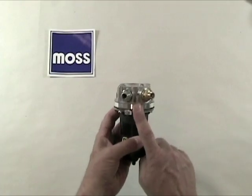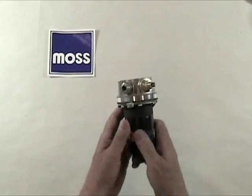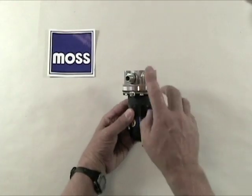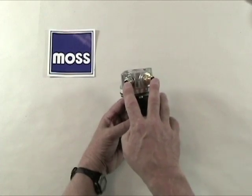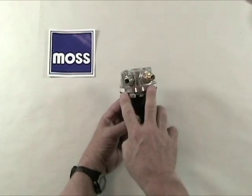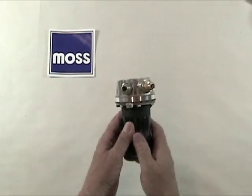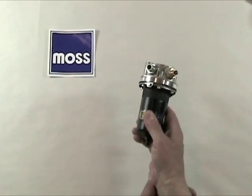If the original fuel pump in your car called for fittings like this 377-042, and those fittings were cut off, you could be in hot water. Those fittings are an odd size. Okay, you can't just call Moss and order up another set of them. Another problem is that the fittings are sometimes available on fuel lines, and sometimes they're not. So the bottom line is, if your lines have been cut and this is the original kind of pump for your car, simply putting this in might not work.